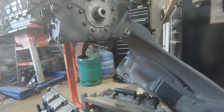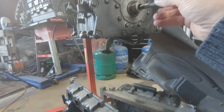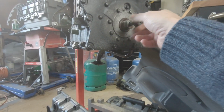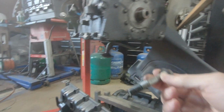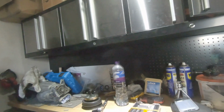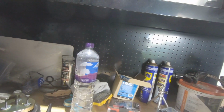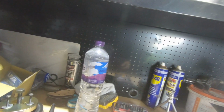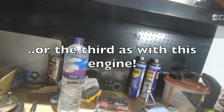So the next thing will be to take this panel off, which I'm just going to put that bolt back in. Wow, actually, it's never good to reuse these bolts, to be honest, because I know you could, but there's a high torque on that, so best not to tempt fate and have it snap on you when you're putting it in for the second time.